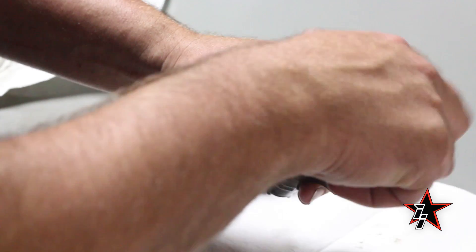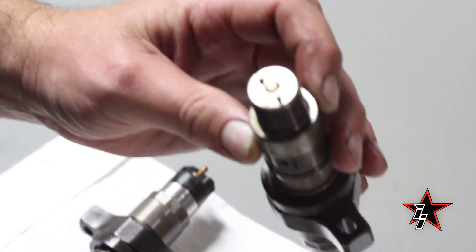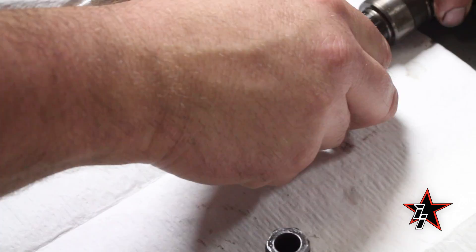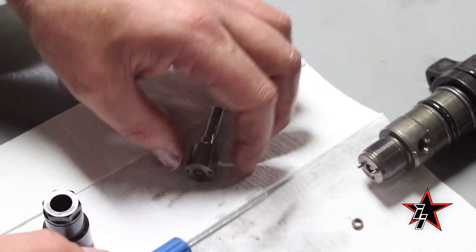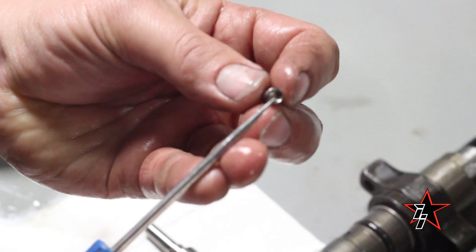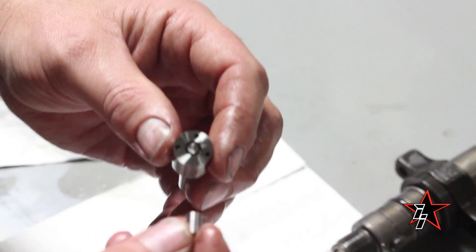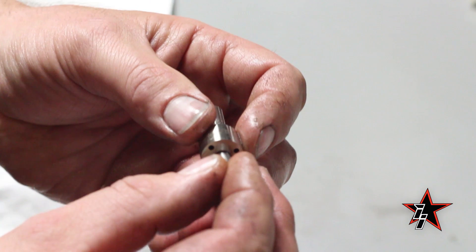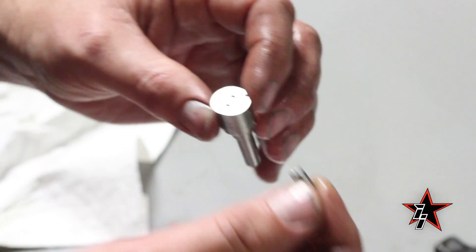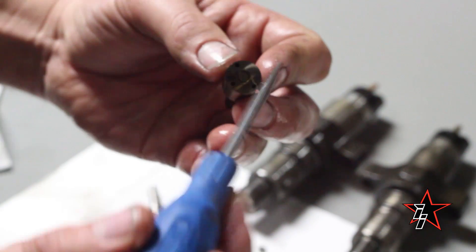In most cases your injector will be the older plunger style. The new style nozzle has a little puck that sits in there flat — if it's not flat, it will mess up how the injector operates and cause it to stick. The new nozzle also has a cutout so the collar can slide up in there. This nozzle only works with this style body; it will not work on the old style nozzle, which has no cutout or cup.